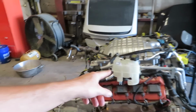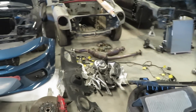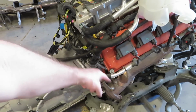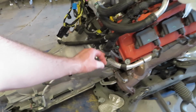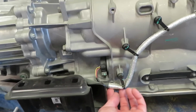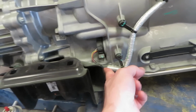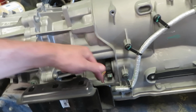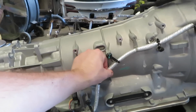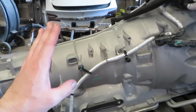And then I want to add this harness, where's it at? Well, wherever the harness is for the transfer case control, I want to just add that to the harness, because the plug comes out here, it goes into the car, and then the wiring harness just needs to go to this plug right here and that plug over there, which, why wouldn't you have that just coming off of this plug right here, or this part of the harness? You have all this room that has no exhaust going by it, and you could just sheath it just like this. It doesn't make sense at all.